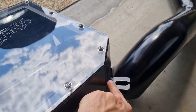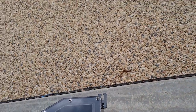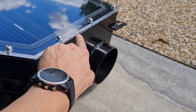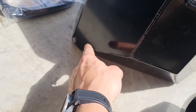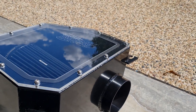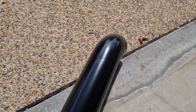There's a bit of weld that's been pushed through on the inside, but it won't be much of a drama. All the welds seem to be pretty good - no holes or anything, which is obviously what you want. It also has a drain down here; if you do get water in your airbox you just take that nut out and drain it that way, which is always good because obviously the idea is to not have water in there. And you have the snorkel itself, which is a five inch snorkel.